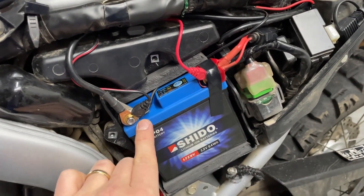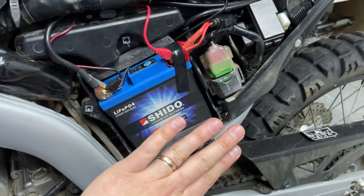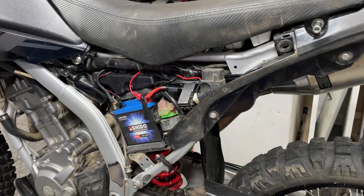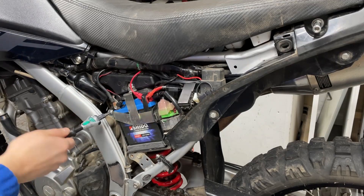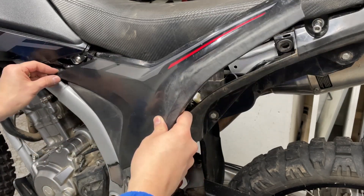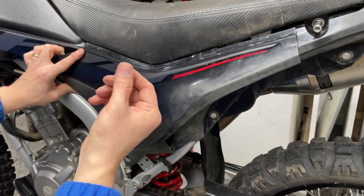The battery is connected now and I've tested the ignition — everything seems fine. I've taken time to route the cables to prevent them from rubbing against any sharp metal edges. The next step is installing the metal bracket that holds the battery, secured by the two bolts — the manual states 7 Nm of torque for each bolt. The battery is now secured, so we put the plastic cover back on in reverse: slide it onto the two plastic pins, push the plastic pin into the rubber grommet, then put the hex bolt in with a drop of Loctite to prevent it from coming loose.